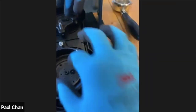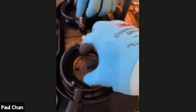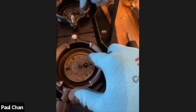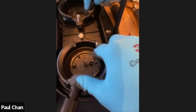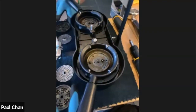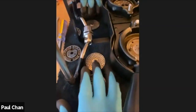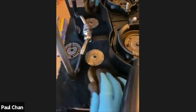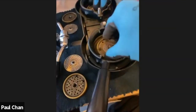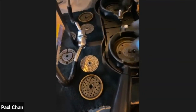And so this is the upper brass part. This part is not detachable. Okay, but how do we clean this part? That is what Dennis was referring to: the cleaning cycle. So as we've mentioned, the blind flushing will only clean the dispersion screen and the upper brass block, which is this portion here. And to clean these two portions, we need to utilize the cleaning function.